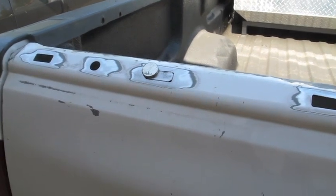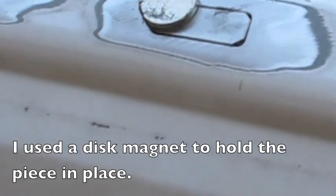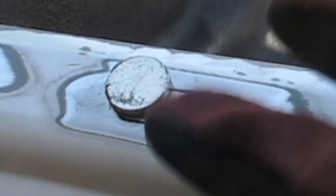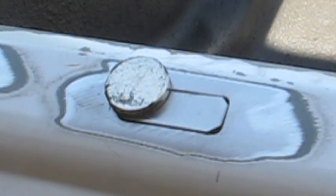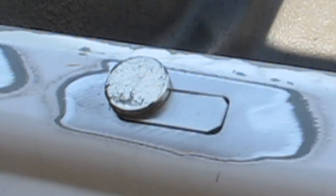I'm going to get a real good close-up of the fit-up here, which I think is really — I'm very happy with the fit-up. As you can see, this thing is as tight as it can possibly be. The little rectangles that I made out of the 20-gauge, I went ahead and nipped the corners a little bit, and that helped with the fit-up. It also helped because these rectangles in the truck are rounded edges. So I'm actually going to tack them right in those corners to try to prevent any problems in the future. So let me get the welder fired up and we'll go from there.